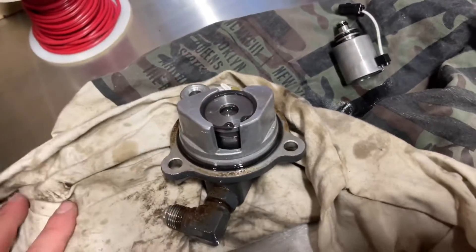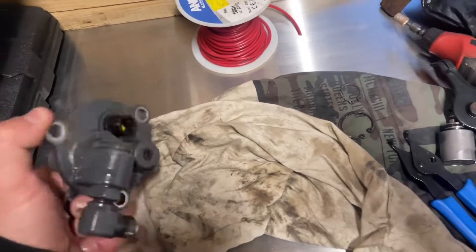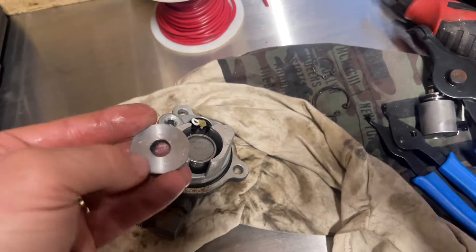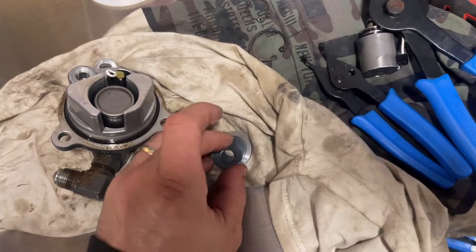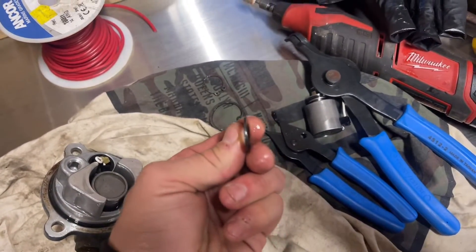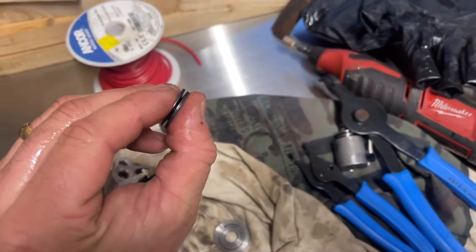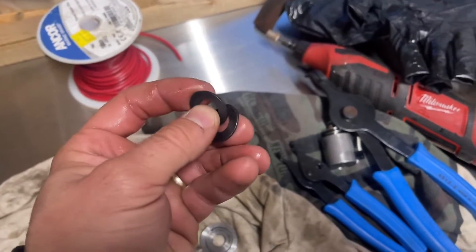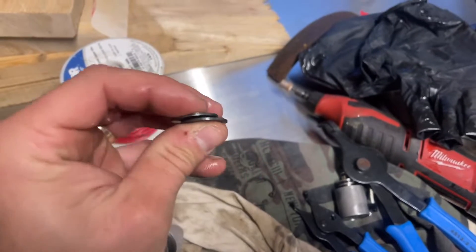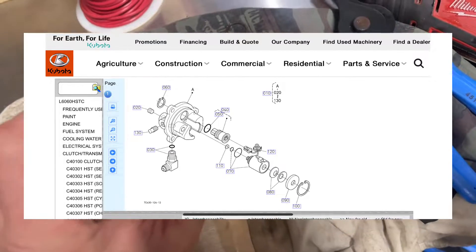We're going to pop this one out with some snap ring pliers — circlip pliers — and show you what we got. Both circlips removed. When you pull this top circlip out you're going to have these two washers. You'll notice they have like a taper to them — a cup shape. If you put them together the same way they'll stack perfectly tight, but you need them opposite of each other. With the circlip in and that piece on top, having them opposite puts the correct pressure on the solenoid, so just make sure they're like that when you put it back together.